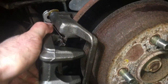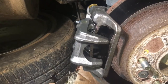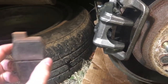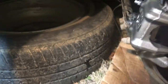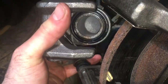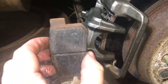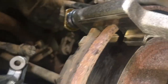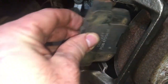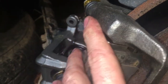Now I'm going to put the brake pads back in and reattach the caliper. If you can't remember how the brake pads went in, flip the pad over on the back — you'll see a little impression from the piston, and that can give you a clue as to how the brake pad goes in. It goes in just like that. Those little silver metal clips are sitting down there and they just make the brake pad slide in nicely.